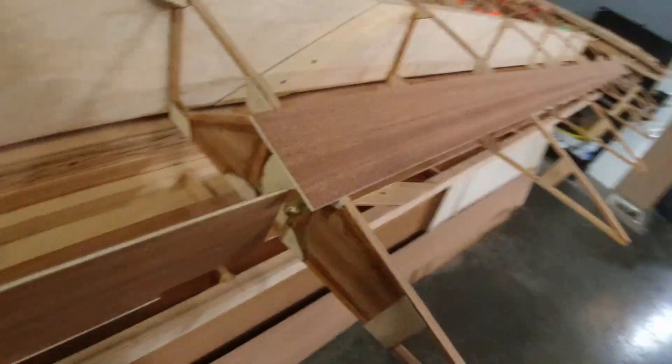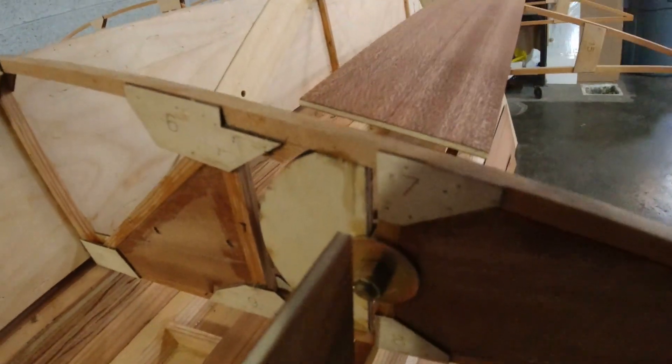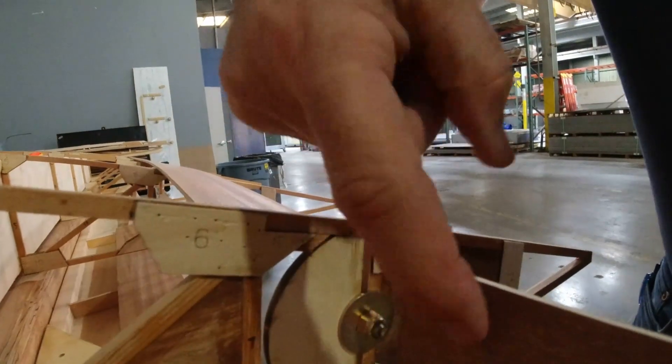Once I get the two of them in there — I can't put them all the way in right now because of rib number five right here. Because of that rib you have to make some cutouts in each side so it fits between here where I've left this eighth-of-an-inch gap. It comes all the way through, meets up against this one, and on the back side you get a doubler that goes over top of it. That's all I've got time for today. I hope you enjoy this, and thank you to those who've subscribed and are following along. I was searching all over YouTube trying to find a good build video and couldn't find one, so I said, why not make one?